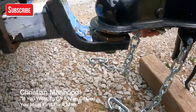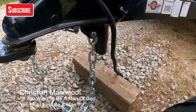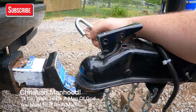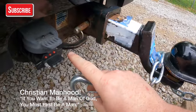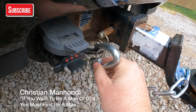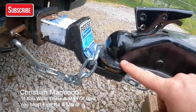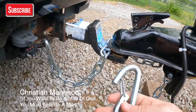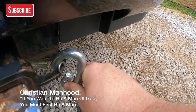But you're not done yet. You have these chains that are hanging off the trailer here. And these chains are very important because you want to connect them to the car. So what you do is you cross them over, cross them across the hitch like that. You're going to look for these hooks here. So take those hooks and connect these two together. These are there for if this ever comes undone, the chains will still keep the trailer — because you don't want to lose your trailer going down the interstate. So hook that other one on there to the other side, just like so.